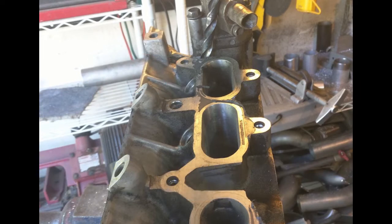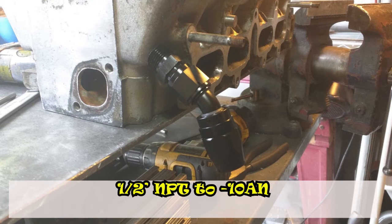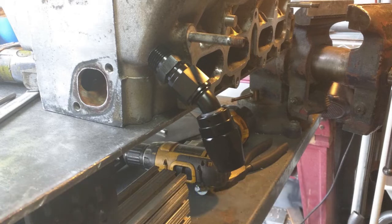This problem can also occur when revving a 4AGE to very high RPM, perhaps 10,000 RPM, which leads to over-oiling the cylinder head and not draining fast enough. Combined with the cornering phenomenon mentioned earlier, this will lead to catastrophic engine failure because the crankshaft won't get a steady supply of oil, leading to metal-to-metal contact. Adding an oil drain in the cylinder head addresses this.